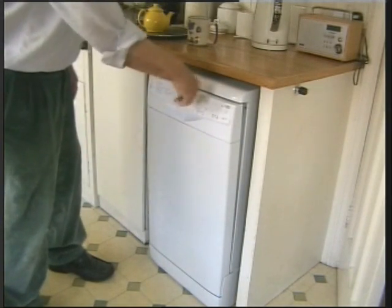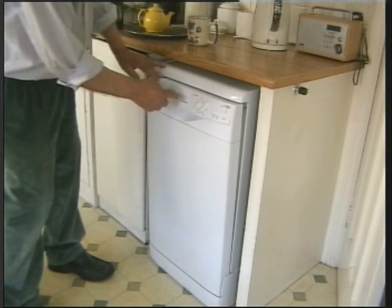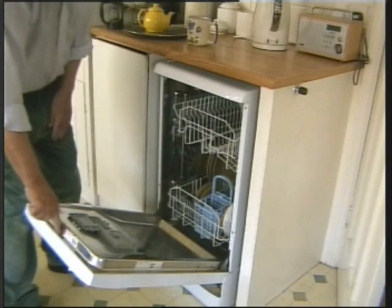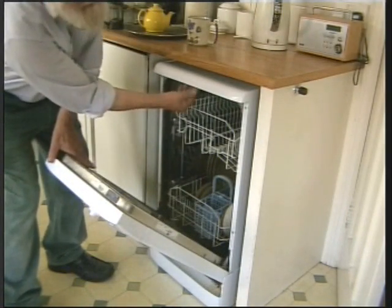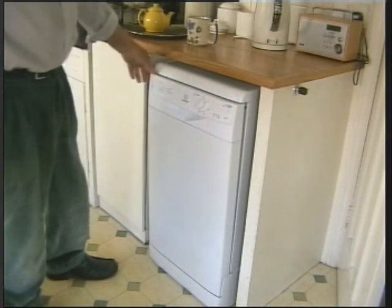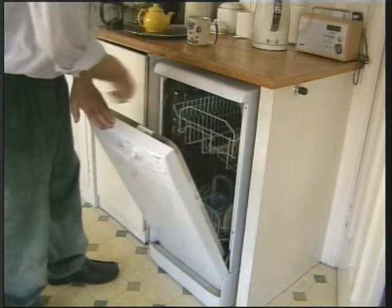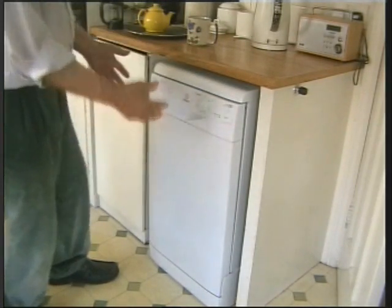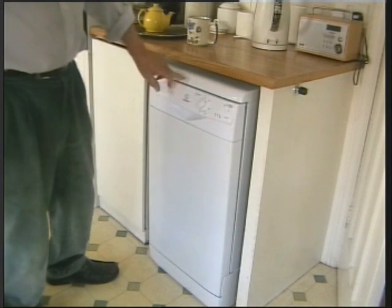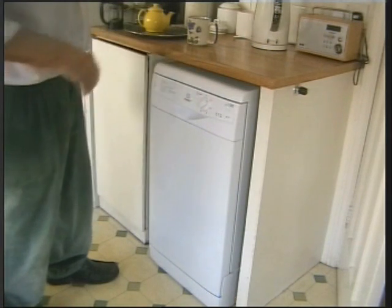It'll come away with cables attached to whatever you've got here. And there'll be a door mechanism which is just there, that engages with a little clip there. They're very problematic but they're easy to do yourself. You take those screws out, take this off, and there are a couple of these that go to that catch — because of the micro switch which stops the machine operating unless the door is properly closed.